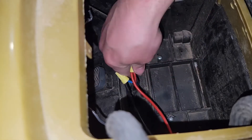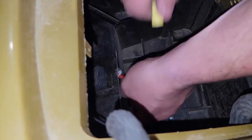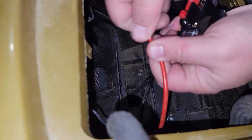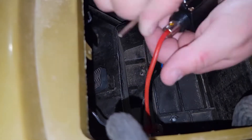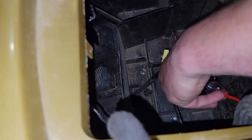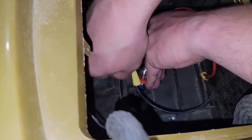We're going to go ahead and mount these in there and see if that makes a difference and stops the kids from catching their trucks on fire. We're going to go ahead and wire up this truck too, even though we have to wait for a new adapter because we melted the first one. We just didn't want you to make the mistake we did and forget to put in a fuse or a breaker, so make sure you do that and we'll send you guys back to the original video.